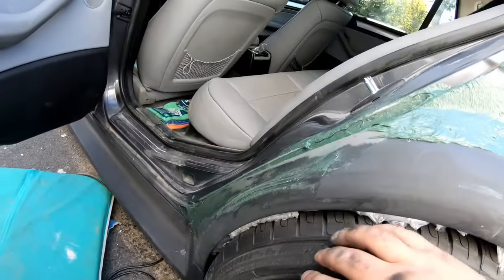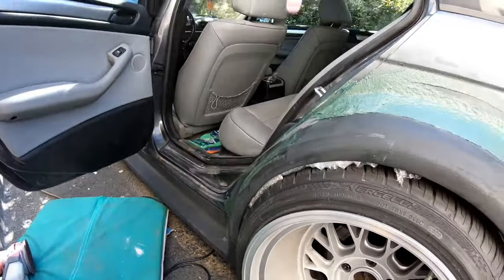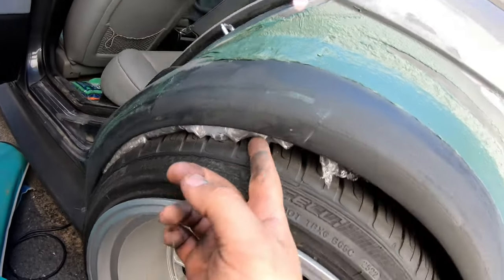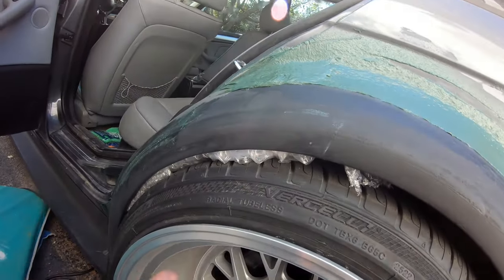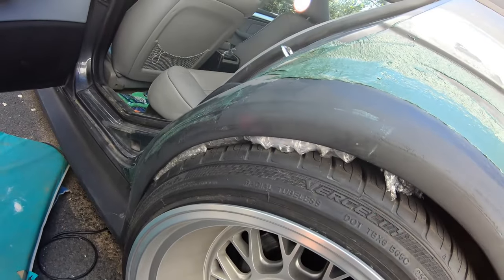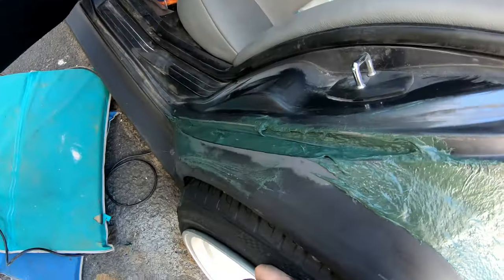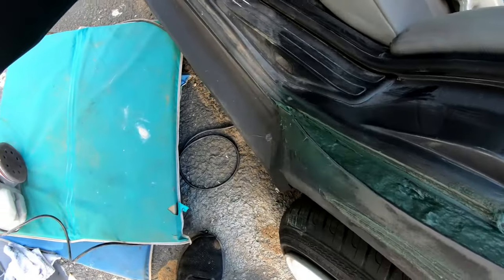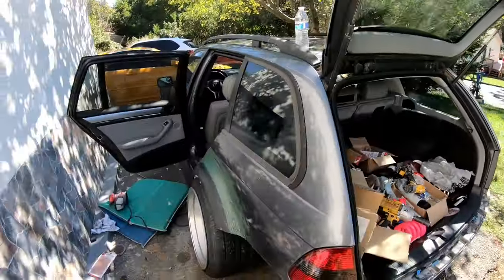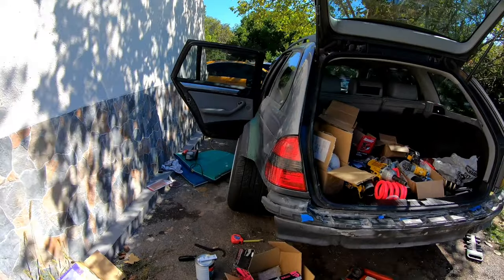So for this, I was gonna put fiberglass underneath to reinforce it. Probably would have been better. Since we're doing the fiberglass bondo first, we're doing that on top, then all these bags that I have here will be removed, sand it down on the inside a little bit more, then we're gonna fiberglass it from the inside to make it nice and strong in one piece. But overall, that's the inside. Also needs a couple more layers, but yeah, it's definitely gonna be sick. I am super excited.